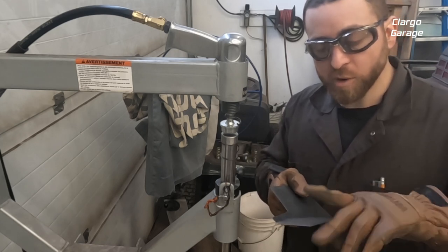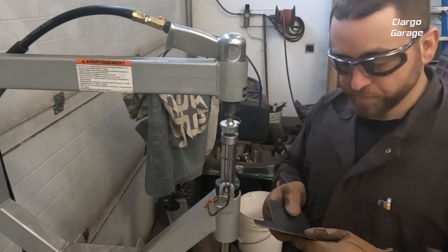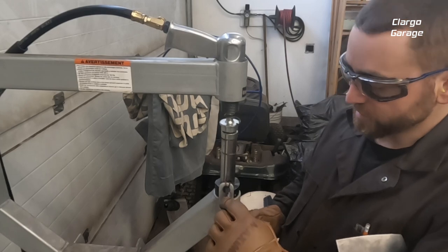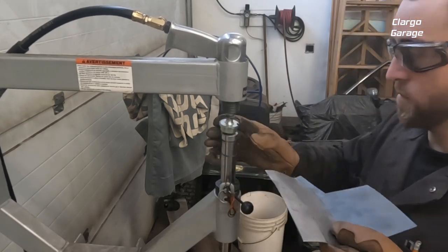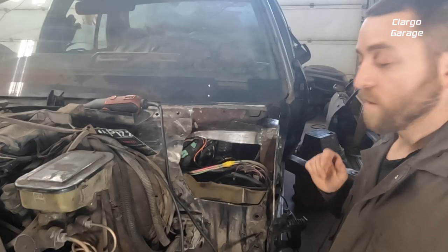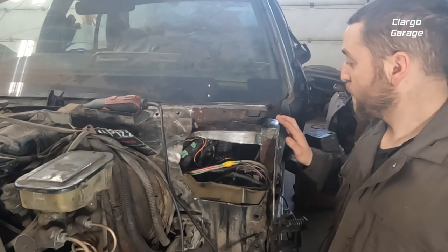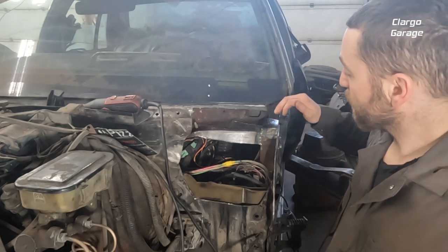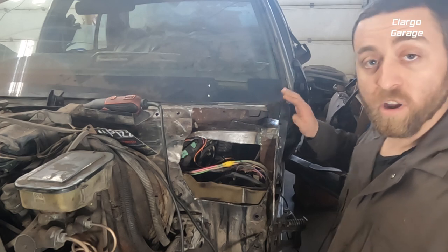I'm going to do this bend too because that's going to distort it a little bit — I might have to go back and forth a bit — and then I'll start doing final fitment. I'm going to switch back to my pre-radius die to start. I'm going to want just a little bit of stretch. We got our piece welded in. I ended up going back in as far as I could until I hit good strong metal. With the windshield still in it's a real pain to get to. I also got this side piece in — it was pretty rough as well — and it's nice and strong and welded in solid.